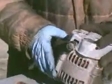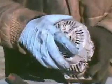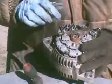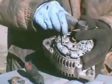What I'm going to do is remove this — three nuts. Remove those, pry it off. This is your diode and this is your brush holder. There are five nuts — one here, one here, there, there, and there — five screws that need to come out. Take those out. The brush holder comes off; you see two brushes in there. And then your diode comes off.